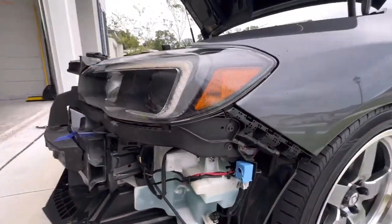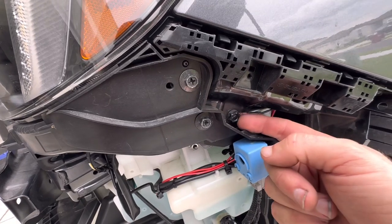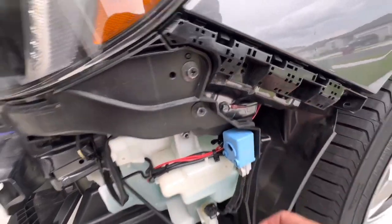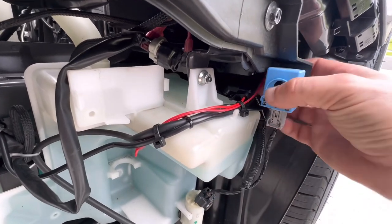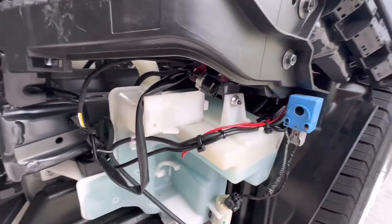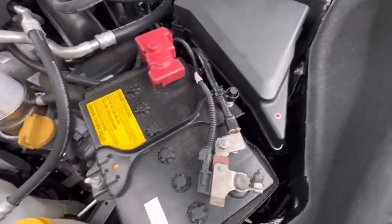So here is my harness now. Here's my ground wire. I went ahead and grounded that. I know that this looks painted, and that's because it is, but once you take this bolt out, both surfaces are raw because they painted this with the hardware already on it. So that should be a pretty good ground. As far as our additional fuse that's provided, that was run in line. In fact, the fuse holder's right here, and that is a 3-amp fuse, but it's tucked nicely away behind the fender here, so we don't see that whole jumbly mess of wires by the battery,